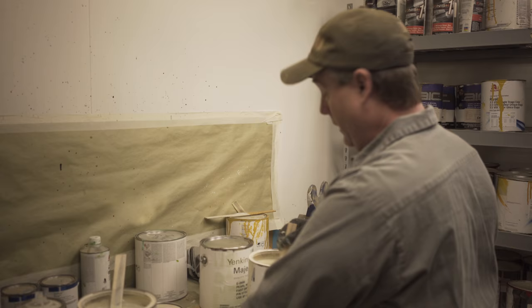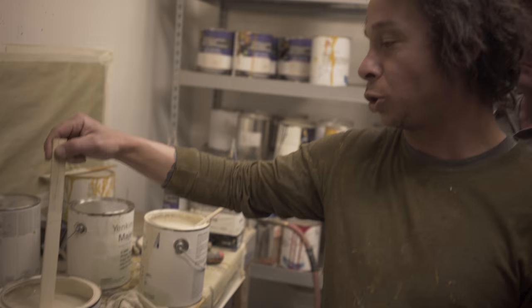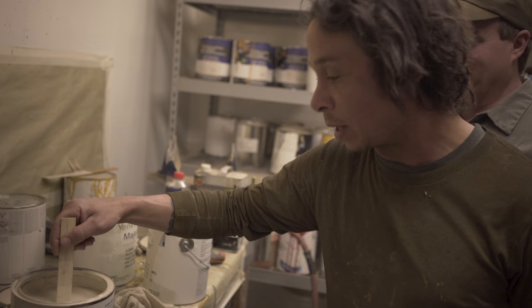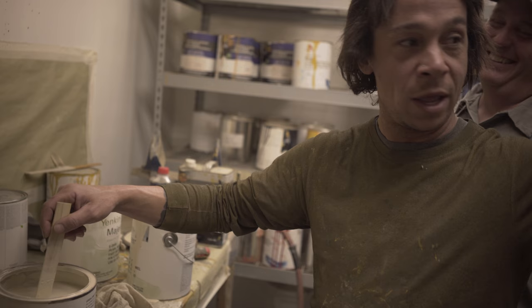You learned some stuff back here, Gus. When you're using your stir sticks, you want to make sure they've got Thompson water seal on them. Because when you stick them down in the paint, if they don't have Thompson water seal on them, they're going to start shredding apart in the paint — it's going to show up like a wood grain in your paint job. So that's something you want to steer away from.